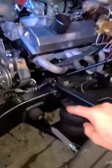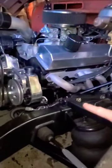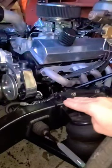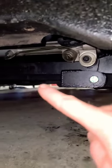What they consider a drop member — basically, a drop member is just exactly like it sounds: it is a dropped cross member, but it's actually raised. On a C10 you're going to be hitting this cross member first if it is factory. This one has been raised, allowing this truck to lay all the way out.